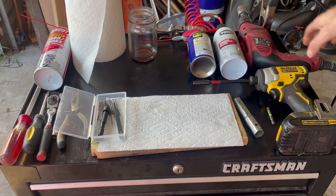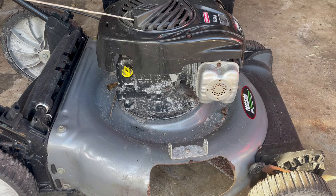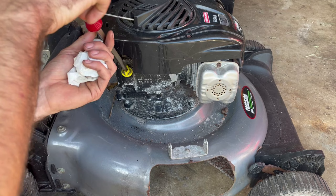And lastly, a power drill with an impact socket — that's going to allow us to basically electric-start our lawnmower. The very first thing we want to do is check the oil, so we don't accidentally destroy this engine beyond repair if it doesn't have oil in it.